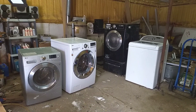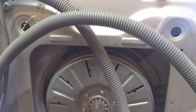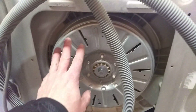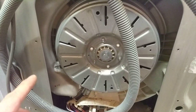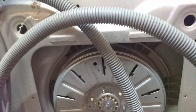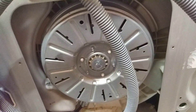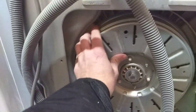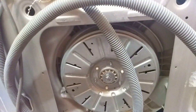These, though — every direct drive washing machine has a permanent magnet three-phase motor, the direct drive ones. Every now and then there's one that's a front loader. Most of the direct drive washers are front loading washers. You want the direct drive for the motor. These motors can easily be made into 400 watt turbines.